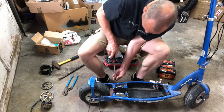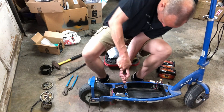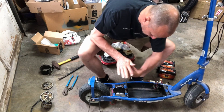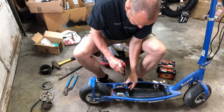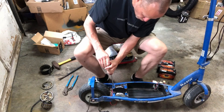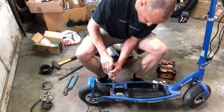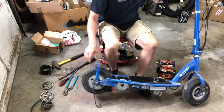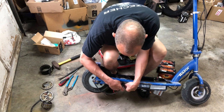The bolt holes line up on this bigger 350-watt motor. I also have a 500-watt coming, but I read the reviews — the 500-watt is thicker and interferes with the kickstand. You have to remove the kickstand and reconfigure the rear brake. This 350-watt clears the kickstand and the rear brake, so it looks like a direct bolt-in upgrade.